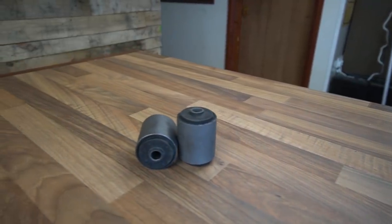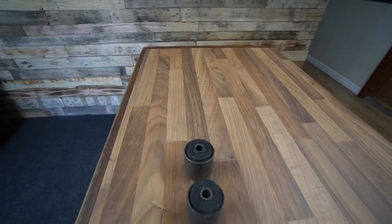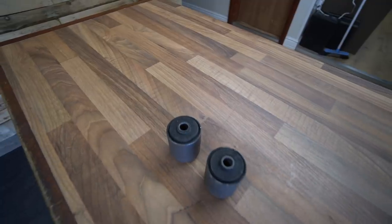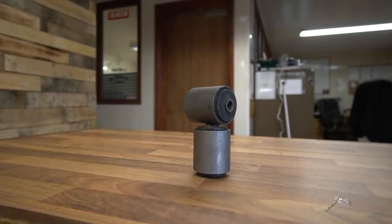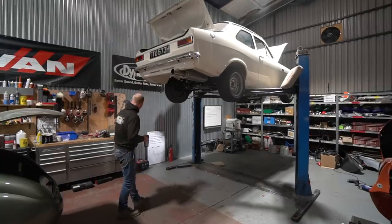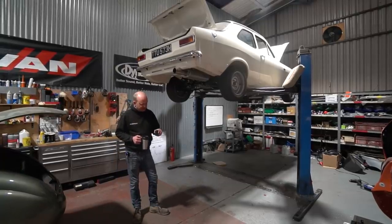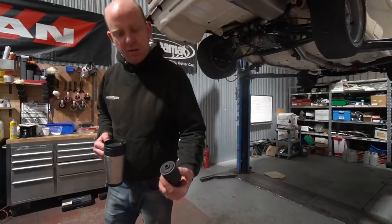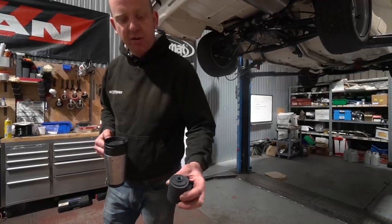45 Shore hardness — which we've now done. There was a bit of toing and froing, a delay in them getting the tooling made and the tubes made. We've had the tooling machined by Dynamic Precision who do work for us, and we ourselves machined the centre tubes for those bushes. With very rapid work by Neil at Bonded Motorspares, he's moulded us several sets of these World Cup cross member type bushes in a 45 Shore compound, to our own drawing and our own tooling.